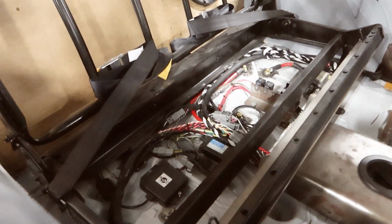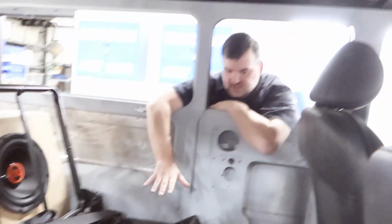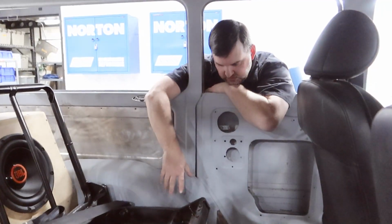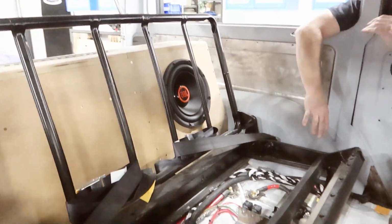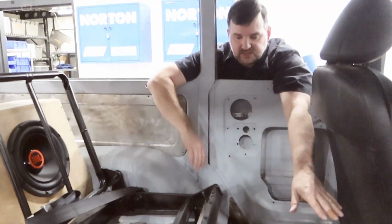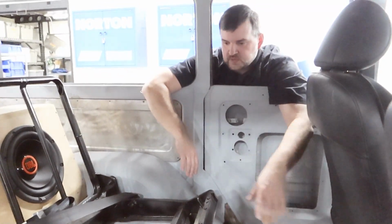So we needed some more room for some of the electrical. This is actually more mainly the vehicle as opposed to the Lexus drivetrain. So we got another large fuse box area to run the light bars and the subwoofer with the amp itself, because the rest of the vehicle is integrated into the original BCM in the Lexus. The fuse boxes are actually the original Lexus fuse boxes, just repurposed.